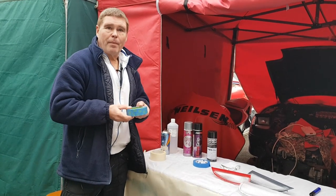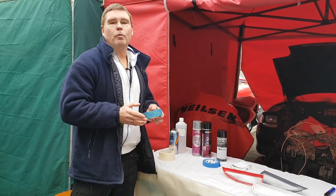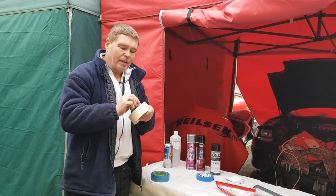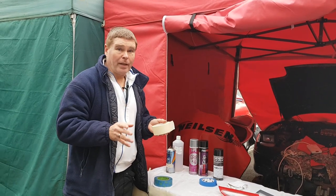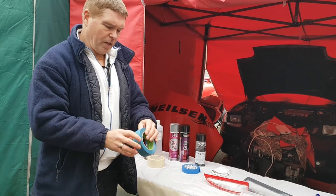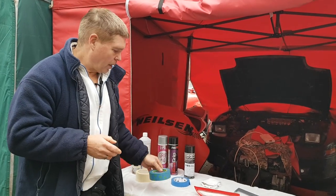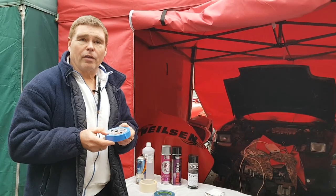You're also going to need some 3M masking tape. Please don't try to cut corners - go into any spray shop anywhere in the world and every professional sprayer will tell you you cannot rush the job. If you use standard tape for masking around corners, the edges will lift ever so slightly, paint will run underneath, and it will totally ruin your lenses. This particular one is called Advanced Edge Locker from Scotch 3M - it's the best I've ever tried and gives 100% sealing from any paint running. In the UK you can still get 3M tape but I had to order it online.